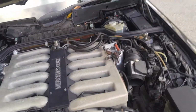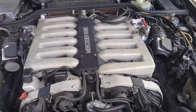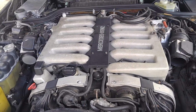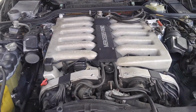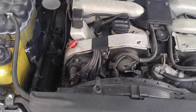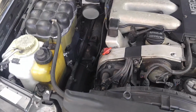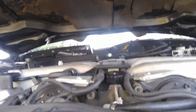Now when I have no air cleaners, there's a lot of air floating around because of the windy day, and it can influence readings from both mass airflow sensors, because if the air passes through them, it can change the way the engine runs. It becomes unstable. Right now it's kind of okay, but again, first things first, spark plugs. I also want to clean up the distributor cap on this side. That one I did, that was pre-burnt, but this one I still have to do. And again, because of the air, the engine runs inside the car, you don't feel it, but let's try to close it. I don't know if I can show it to you.